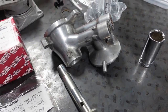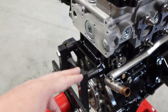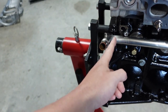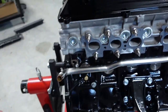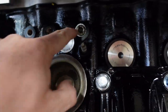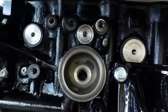So I eliminate that adapter, which also allows you to eliminate the pipe that wraps the whole way around the block, head, and all that stuff. I use the NA pipe, cut it here, run it up into the heater core, then it comes back into the head and goes through. That eliminates a failure point — it doesn't wrap around here anymore.